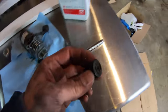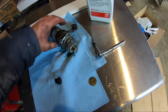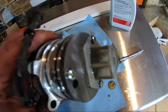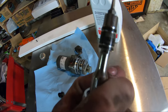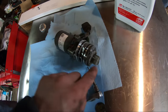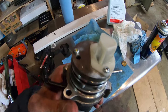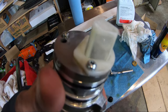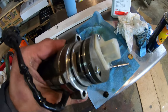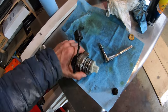This is the fill and level plug right here. Now I'm going to clean the pump. There's a mesh filter on it — you can either spray brake cleaner through the mesh, or remove it using a T10 Torx bit, take it off the pump, and wash the pump and mesh separately. There was a little bit of residue and gunk under the mesh. I don't think they sell that filter separately, but you can check. I cleaned and sprayed it out — it's all clean now.